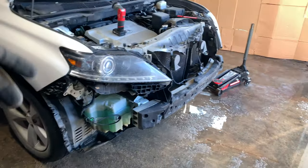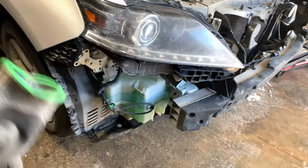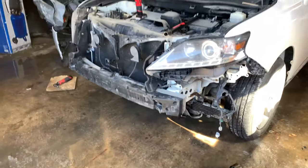All right, so if you've done everything right, the bumper should just come up just like this. There's one connector that needs to be disconnected over here, and on this side there are two. That is it right there, and then the whole front bumper just comes off.